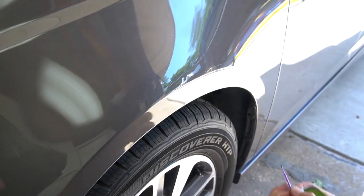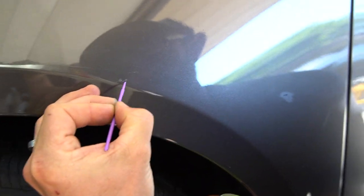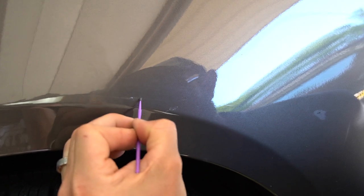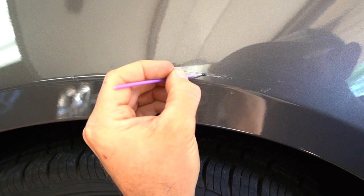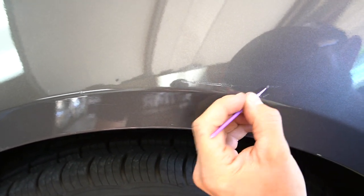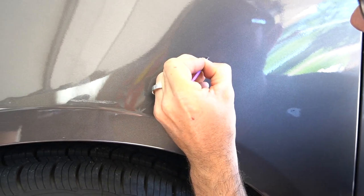So again, trying not to overthink it. Trying to hit those heavy areas where I know the paint is missing, like here. So you're applying it and it's clearly going outside of the scratch on top of the paint, right? And that's okay? Yep. Okay. Yeah, because the way it's looking now, this is a wide tip applicator, it'll fill in and fit in that low spot. Your eye is just seeing how wide this tip is. And actually I think my touch-up pen might be a little bit smaller, so I might switch to a different applicator as we go back and get some more touch-up paint.